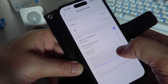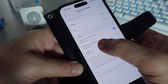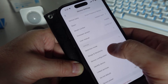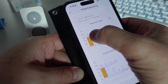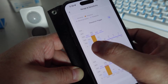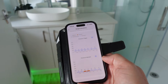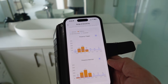Going into the device settings, there are a number of things we can change. We can select the detection mode: radar first with PIR assistance, PIR first with radar assistance, or radar only — and there are ramifications to both response speed and battery usage from each selection. We can also adjust the sensitivity by clicking a zone and scrolling to change the level. Because I selected 3.2 meters as my maximum distance, the 4, 5, and 6 meter zones are not enabled. I really like that you can watch exactly what's happening with both the presence and the PIR readings via the bar display.